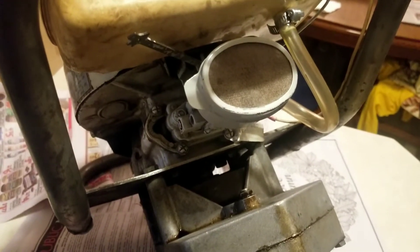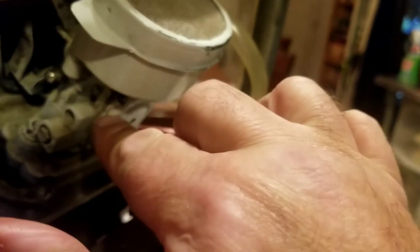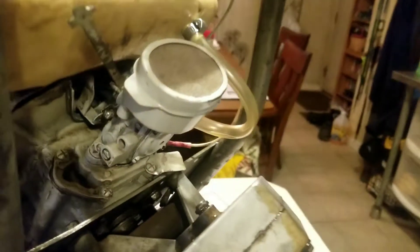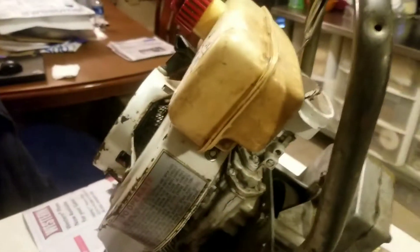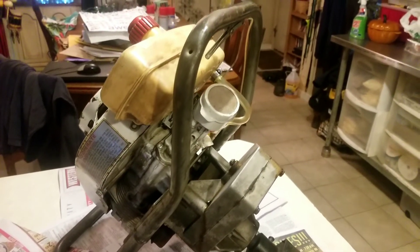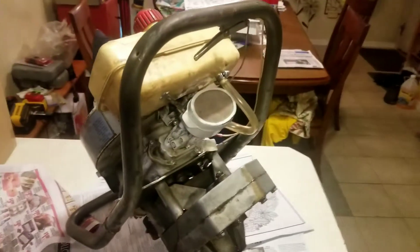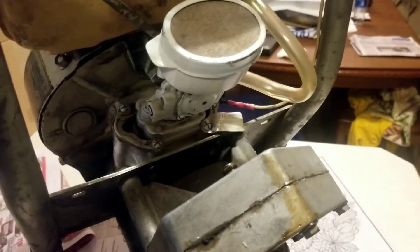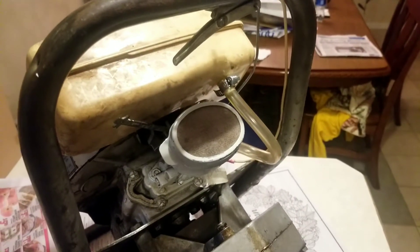All we need to do is clean and adjust the carburetor. If you look closely you can see white paint still on the gasket and diaphragm area, which means this has the original carburetor gasket and diaphragm on it — this is an older unit with a cast iron cylinder. We're going to pop the spark plug out for a compression check, then pull the carburetor off, replace the diaphragm and gasket, and check the needle and seat.